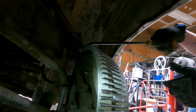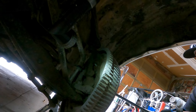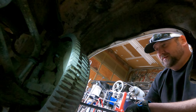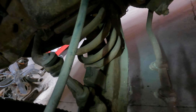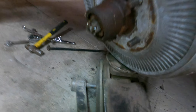That thing looks like it's moving — it's moving all over. You have to disconnect the strut rod, sway bar, and the shocks. Grab some wrenches and let's do this. We got our ball joint popped off of there, disconnected the strut rod, and disconnected the sway bar. We have the jack under that sucker for some insurance. Then she released — be careful. Now you got to disconnect the shock.